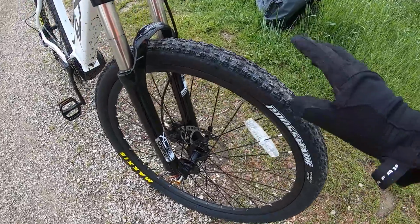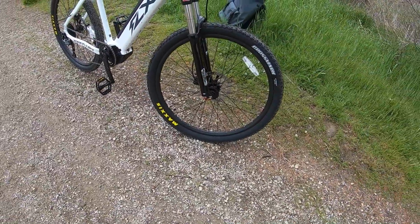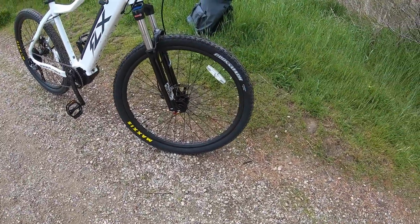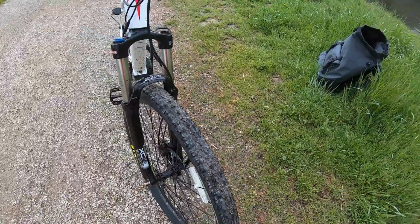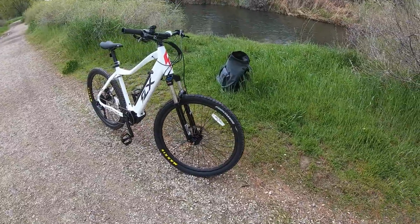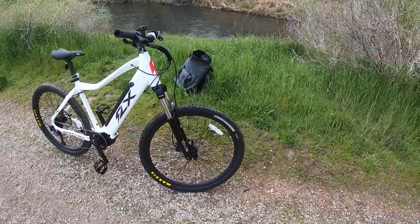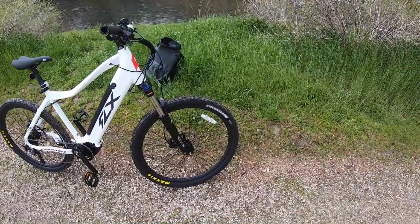So this is the 27.5 inch tire. That means that the diameter of it is 27.5 inches, and it's a 2.1 for width, meaning that it's 2 inches, 0.1 on the width there. That's kind of like a standard mountain bike size these days. You do have some that are a little bit wider, some that are a little bit shorter, everywhere in between, but the 27.5 is a good, kind of like a middle point for all of that.